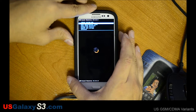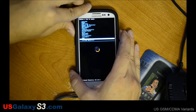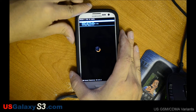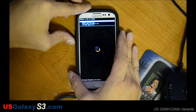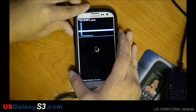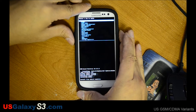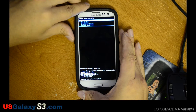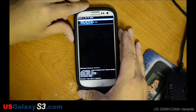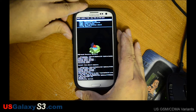We're not updating the bootloader. I'm going to install zip from SD card and then choose zip from SD card. I put it in a folder called ZUpdates so it would be at the bottom. So what you're going to do is just flash these two files. You can see that I tried to do the bootloader but it won't let you — I believe this is because it's not on a stock setup. I'm going to research that a little bit more and see what we can do about the bootloader or if it's going to affect us in the future.